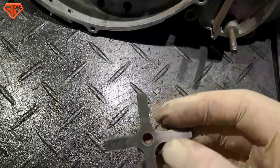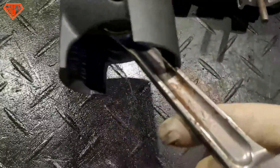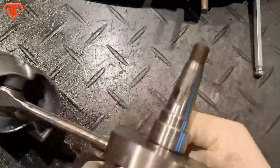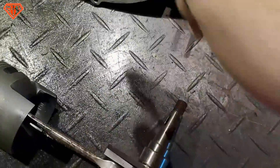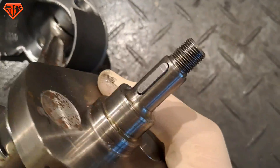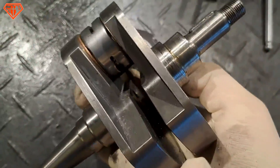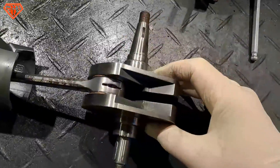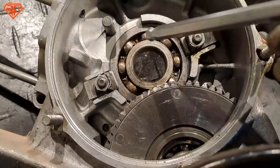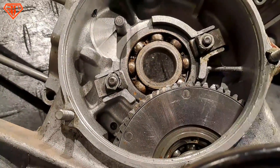We have a King crankshaft — it's 480 euros — and it is also rusty, look at that. I'm sure the taper is not sandpapered with the flywheel. I'm curious how the static balancing is. This bearing is just an 8, not a 9, it is rusty and you cannot move it anymore. Someone beat out the stoppers for the bearing here, so this is already damaged.